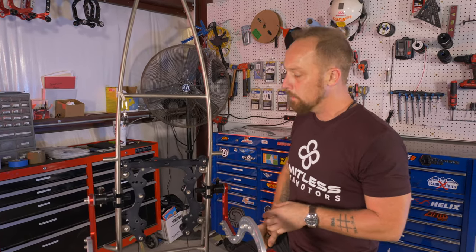Reason being that when you are on speed bar, you decrease your angle of attack. So I'm gonna do my best to draw a paraglider, paramotor wing on full speed bar. Basically, might even be a little bit more like that to make it correct. Again, forgive my artistic abilities. As you can see, wings pointing down like that, but you've got this propeller like this. It's kind of fighting itself. It's pushing upwards, unloading the wing, losing speed because you're not maximizing the wing loading you potentially have. They're kind of fighting with each other.